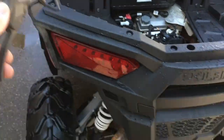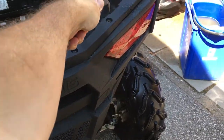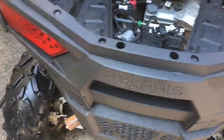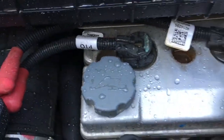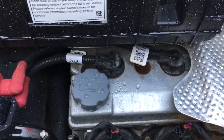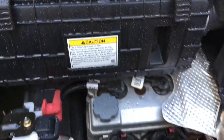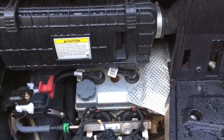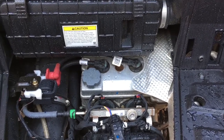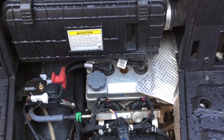I have my air hose, my compressor. I just quickly blow that water out. Okay? Simple as that. Also, on the engine, there are 2 holes where the head bolts are, down in there. See how they're full of water now? I really don't want those head bolts sitting submerged in water and corroding, because heaven forbid one day I need to pull this head apart and do some work to it and the bolt snaps. I'm just not going to be a happy camper.